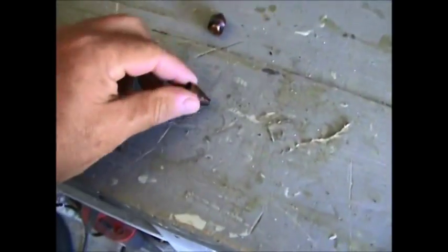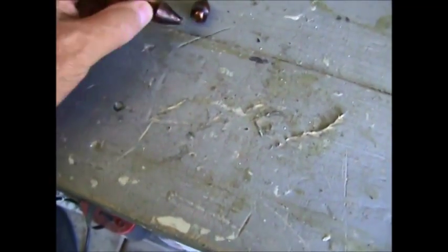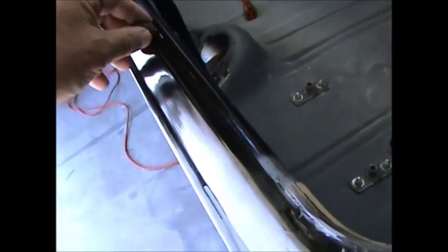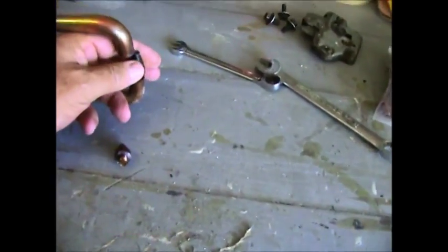I'm going to shave one pair, not the original ones here, but I'm going to shave one of the new pair down to fit. I thought of leaving this one in and getting a brass bolt to throw in there and then just taper the bolt down, because the brass bolt would fit in the channel, as you can see. But a friend of mine told me that it wouldn't work that way. Even though it's resistance welding, it still wouldn't work that way.